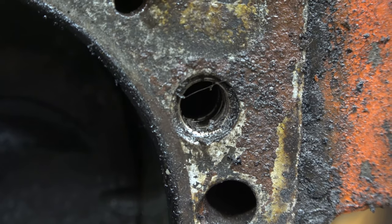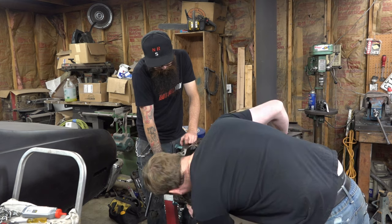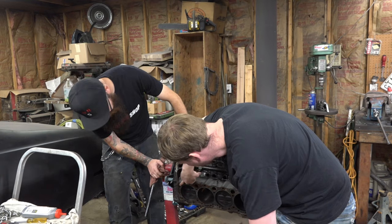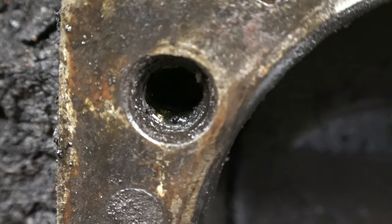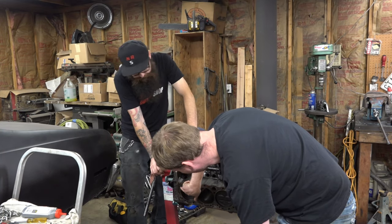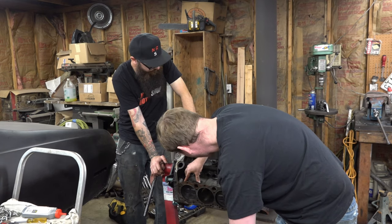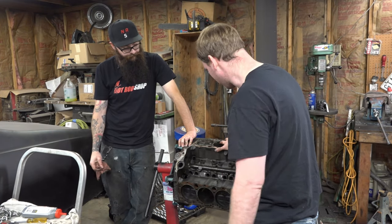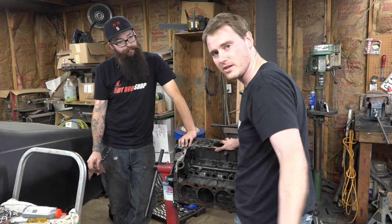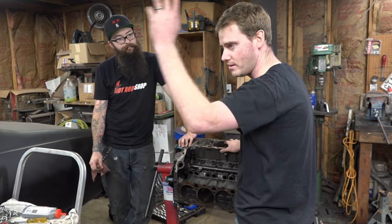As we've been messing around with it, we found that three of the head bolts going into the block are helicoiled — one up here and then two on this head, one there and one there. This one looks like they had a hell of a time trying to get the bolt out because the hole is really big and it's getting pretty close to the cylinder wall. I'm worried that if we try to put a bunch of power into this it could crack right there, or you might get a hot spot — it's just not good. This block is in quite a bit worse shape than I thought.